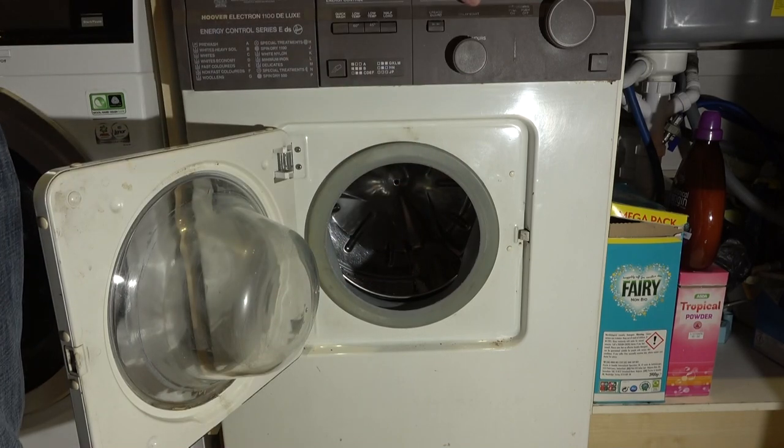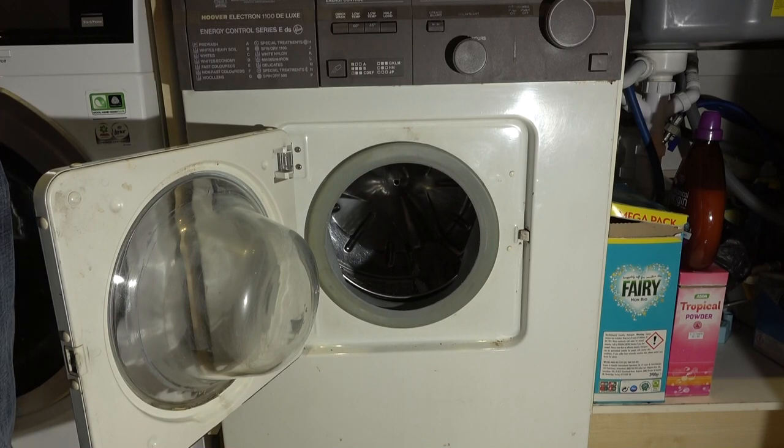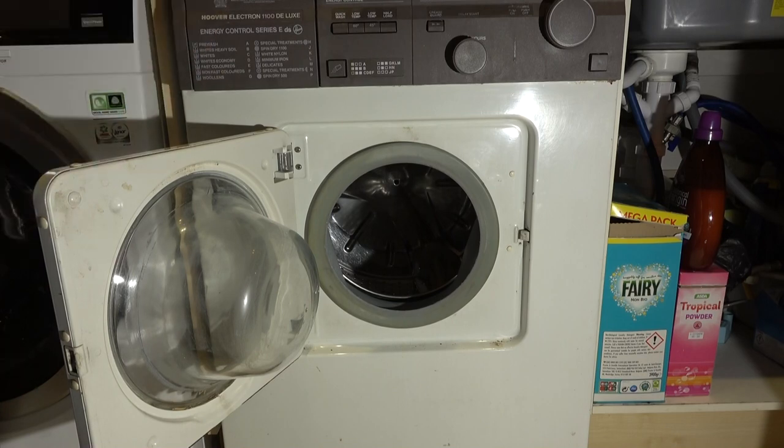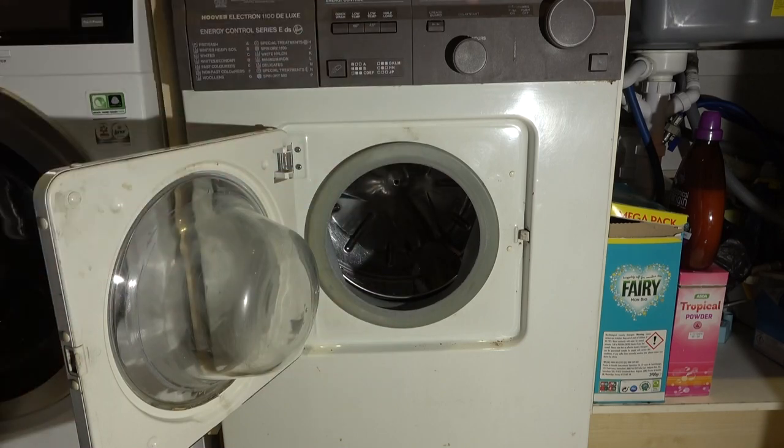Stops kids from smacking in the dial, stopping the machine, and then trying to undo it, possibly flooding the kitchen. But it won't do that anyway, because it's still got a 2 to 3 minute time delay door lock with it as well, which of course will engage when the water level is too high, if it's too hot, or if the machine is still spinning.